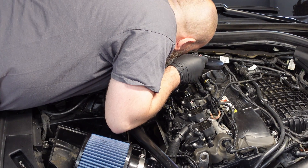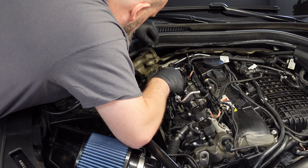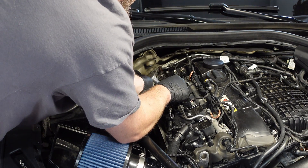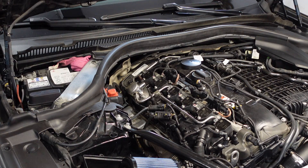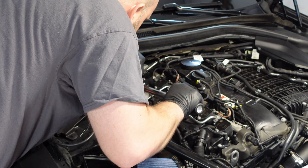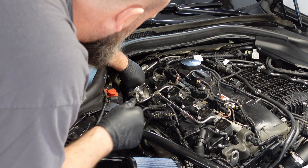Alright, let's take a look — make sure it's even around. Looks good. From here I'm going to give it some five ratchets each. It's starting to get snug. Torque for these is 12 Nm, but this torque wrench goes to 14.1 Nm, so we are doing 14.1 Nm. That was close.